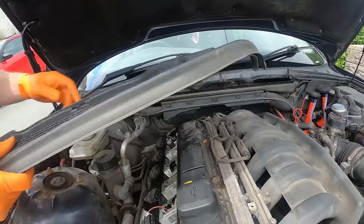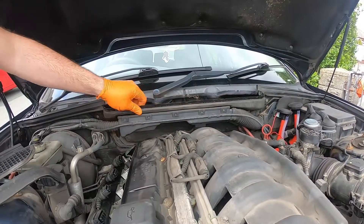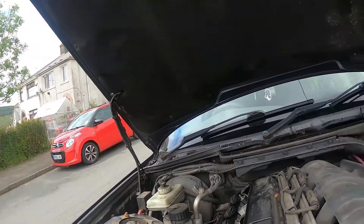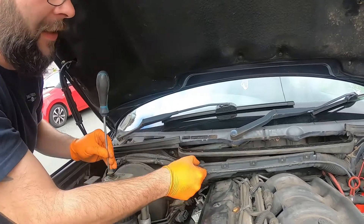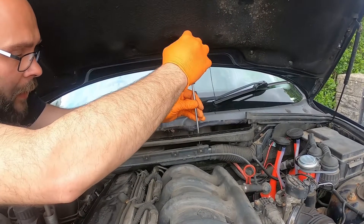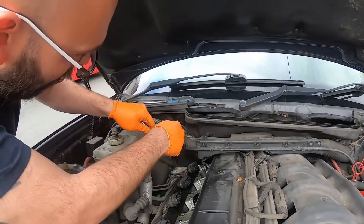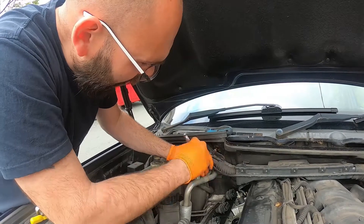You can get access to two Phillips head screws right there and also one over there. Once unbolted, this piece of wiring along here can be pushed down and out of the way. Then I'm going to tackle these 8mm bolts so I can pull this whole panel out of the way, giving a straight view down to the rocker cover. It's not essential but it makes life so much easier to get to the bits at the back. Better to work smarter, not harder. Note these bolts turned out to be 7mm — a slightly stranger size, not the standard 8mm I originally thought.